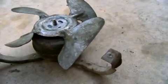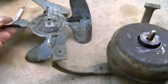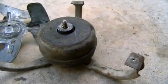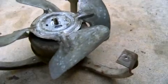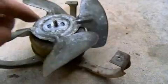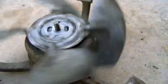I pulled this out and cleaned it up because it was quite a bit dirtier, but there's supposed to be a rubber washer that goes in between here and here — you can kind of see maybe where that was. The purpose of that washer is about a couple millimeters thick. It's not super thick, but the purpose of that rubber washer is to act as a pad and a spacer, because you can see this almost rubs on the motor. It also acts as a friction grommet so that the fan makes a good bite onto the motor, because it's just completely smooth all the way around — nothing there to keep it from spinning right on there.